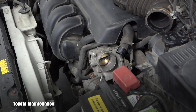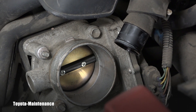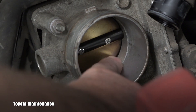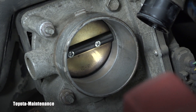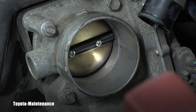And that's probably what all of us were expecting. Look at it — looks pretty okay, but look on the bottom where the idle air is supposed to be moving. This is unfortunately dirty. Look on the bottom: when I move it, that is carbon build-up, and that's a problem. It's affecting the idle, and I mentioned already in this video that this car actually has idle going up and down — up and down — and it's not because of the AC compressor load.